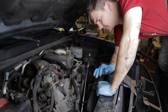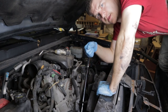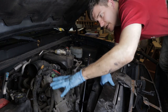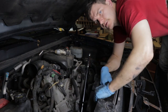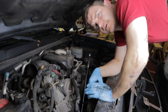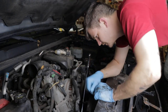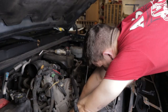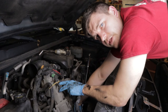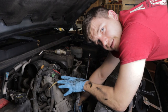I'm just getting finished routing this belt. I'd definitely recommend doing this with a friend so someone can push the belt up from the bottom while you're pulling up — it's a tight squeeze. I'd also definitely recommend removing the airbox like I have here, because you need to get your hand down into the tensioner pulley. My goal is to have the last pulley that goes on be the alternator. One thing I'd highly recommend — and I'd say it's a must — is to put the new belt in with clean gloves and don't get any fluids on it. Belts like to work clean and dry.